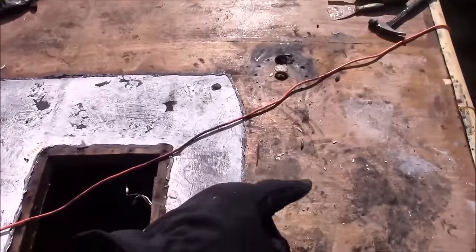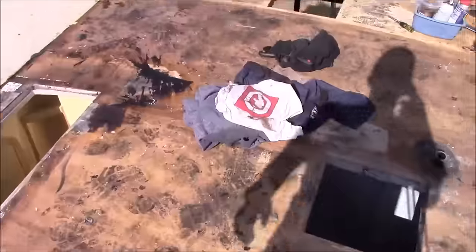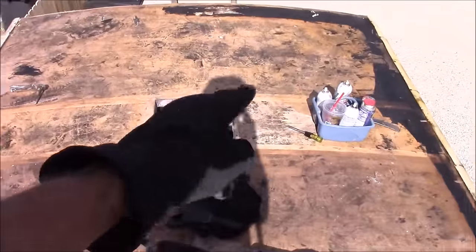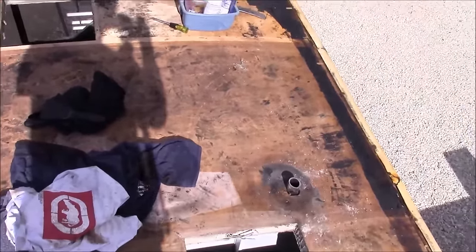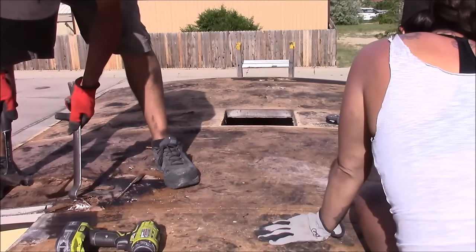Because my roof was in such bad shape I've got to replace some of the plywood — a full piece, a partial sheet in the back corner, and another full piece. For the majority of RVs and motorhomes with a rubber roof, it usually consists of a layer of plywood on top about a quarter inch thick, followed by a layer of rigid styrofoam about an inch and a half thick, which also includes either wood framing or steel tube framing for structure. Then on the bottom there's another quarter inch sheet of plywood. With all these materials combined it gives you good lightweight structure that's pretty strong.